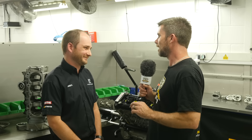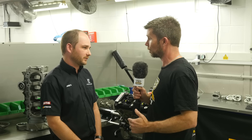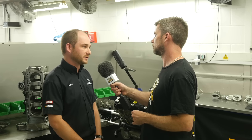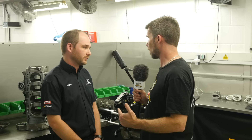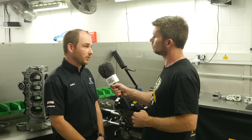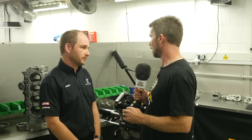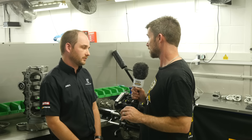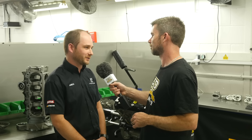Unusual in the motorsport industry, you actually offer a warranty on these engines. How long will one run under race conditions? We offer a 40-hour warranty, which equates to around 3000 to 4000 kilometres. At that point when the engines come back after 40 hours, what maintenance is normally required? Providing it's been well maintained and warmed up to temperature, it's bearings and rings — that's the standard one. For a very high-revving V8 producing impressive power output, that's a pretty basic maintenance strategy. It's taken a few years to get here, but it's a durable engine.